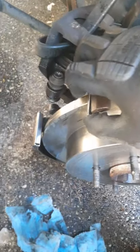Same thing for the top one — pull it off, spray it, and brush it. I'm sorry this video took so long because brake jobs are actually pretty simple. I'm just trying to walk you through each step. In this video I've shown you how to remove a stuck rotor if need be, because these things do get stuck.